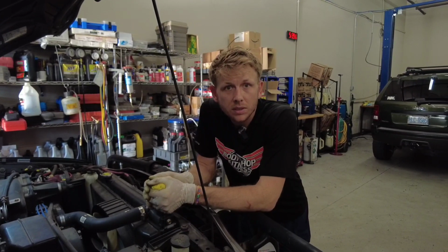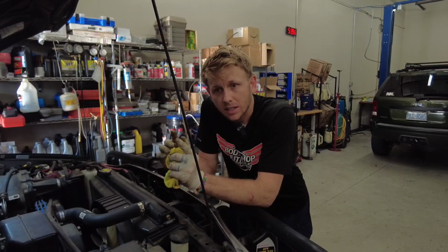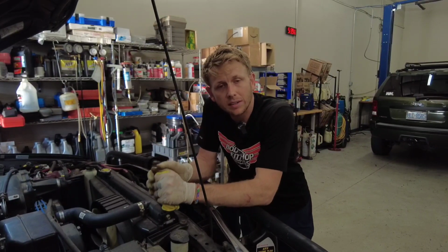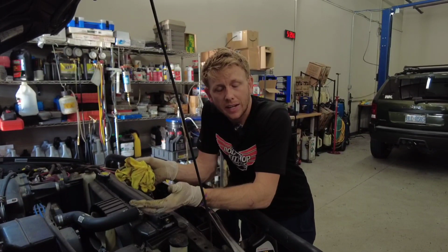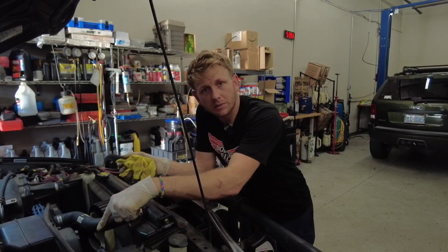Well, I hope you learned something. Thank you for hanging out with me after hours today. And that again is a very quick, clean way to change your transmission fluid if you have a dipstick and a fluid evacuator. Fluid evacuators are also great for things like power steering fluid.